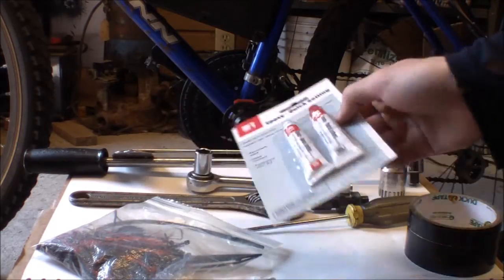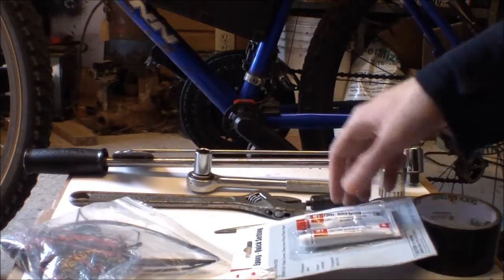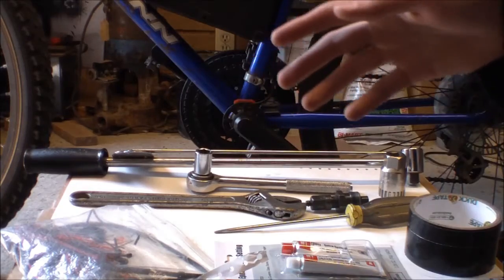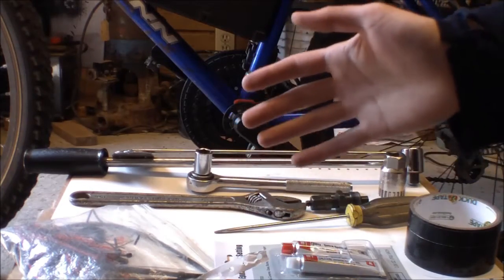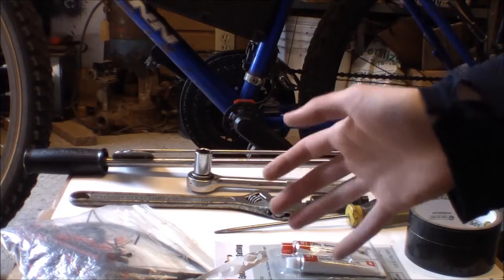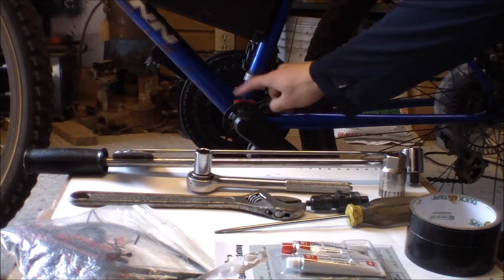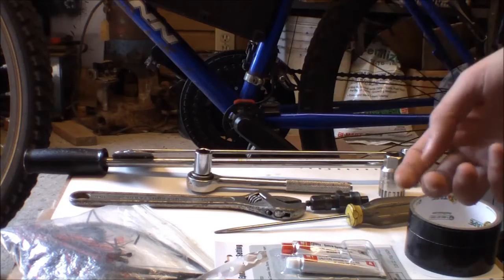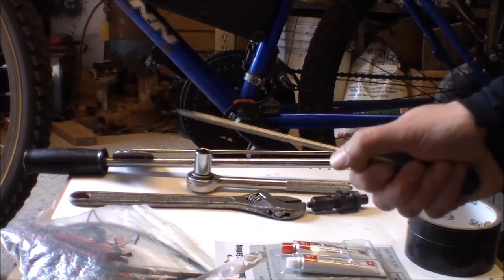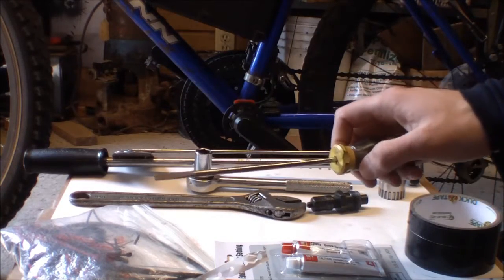You may also need epoxy — I didn't use epoxy, but it's a good thing to have; we'll get into that later. I recommend that you install the pedal assist system onto the bottom bracket itself, and to do that you're going to need some tools to remove the bottom bracket and maybe some of the cups. To gain access, you're going to need a flat head screwdriver.